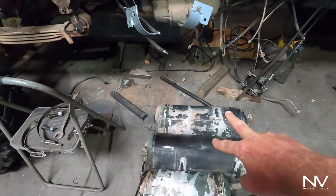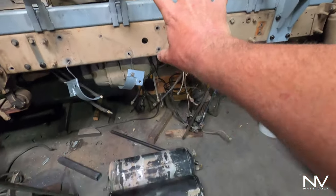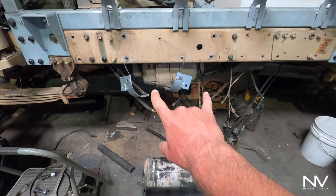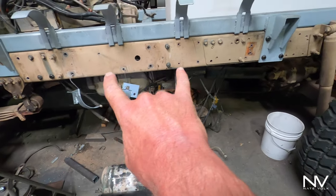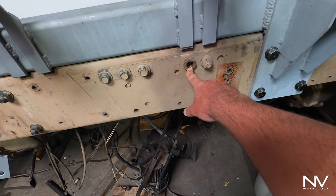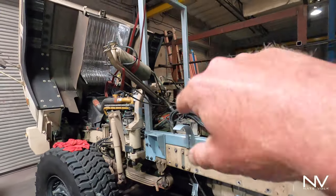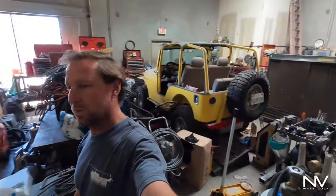The two longer tanks are going to sit up here, one there, connections in the middle. The lower wet tank is going to sit down below. I just kind of touched up paint on everything so it's just hanging — those aren't mounted. The new air dryer is going to go back here, close to the factory spot, with the through-fitting for the airline.